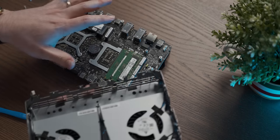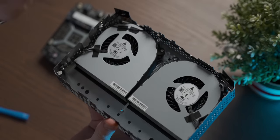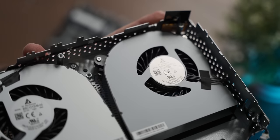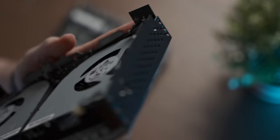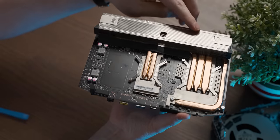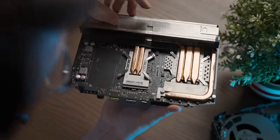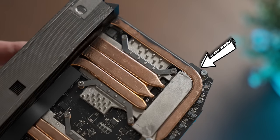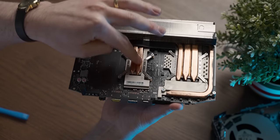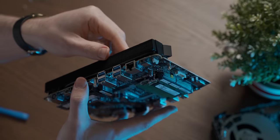That is the motherboard. But first I want to show you the pretty substantial fan array — these are some big blowers made by everybody's favorite fan company, Delta, so they can probably go 7 trillion RPM. That fin stack would give the average gaming laptop a pretty serious inferiority complex. The insides of this Intel system make it seem like the hot older brother of the AliExpress system I looked at ages ago. It's got about five heat pipes — one heat pipe cools some of the memory and power delivery for the RTX 2060 that's under here — and then we have our i7 laptop chip in here. These internals are really cool.